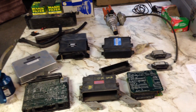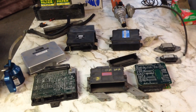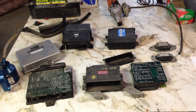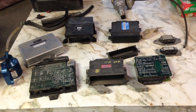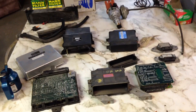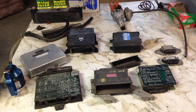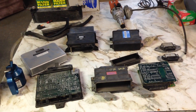In my car, it was a budget build, so I needed to find a good way to do it. I knew that Saab and Volvo used an EZK ignition system, which is a digital system with maps and all that. It uses a knock sensor, which is even more beneficial for those turbocharging, and it uses the knock sensor in conjunction with the programmed maps to determine timing.